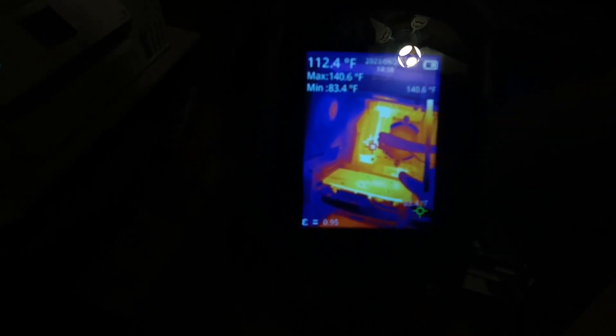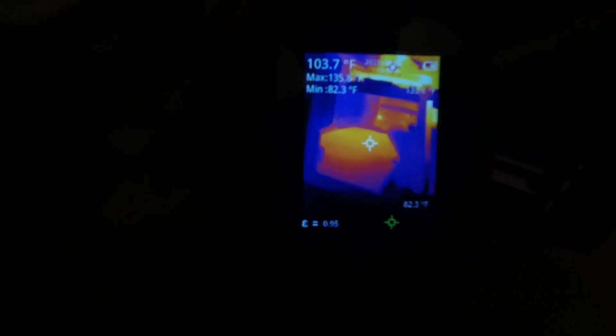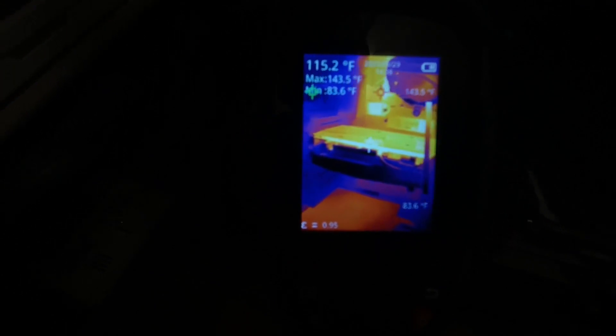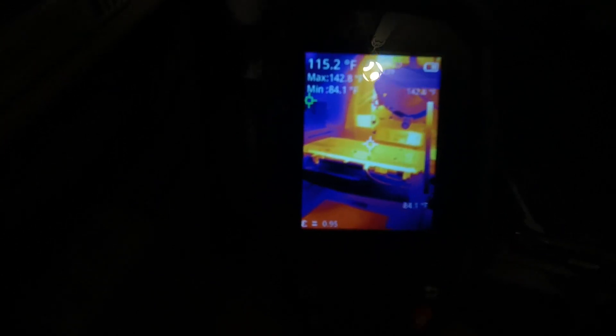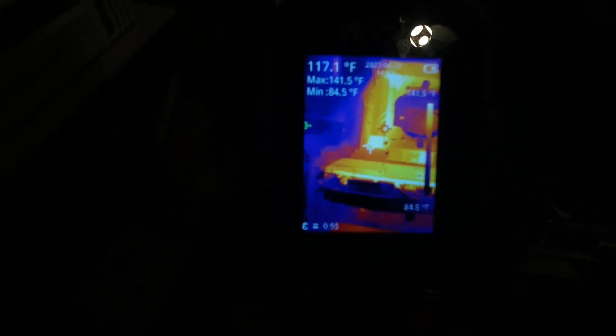This back here is an M.2 drive, and over here are some of the voltage handling chips. Down here — you can see it's half covered by the video board — that's the AMD chipset. The power supply is down here at the bottom, and you'll see the power supply isn't even very hot; it's only running at about 100 degrees. The video board isn't doing much right now because I'm not playing the game — it's running at about 116. The hottest spot looks like it's those power control chips at about 141. You can see the red hot spot keeps bouncing around that one spot. The RAM memory is here and it's not hardly even warm at all.